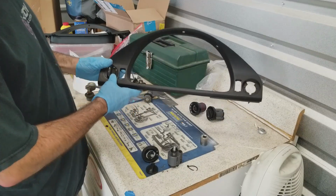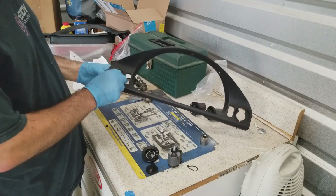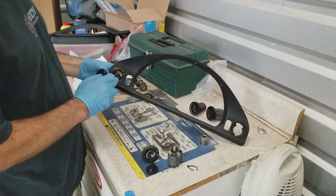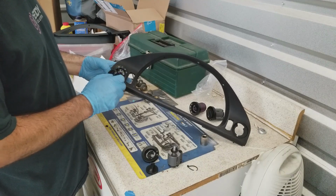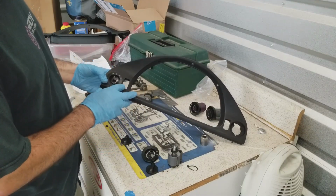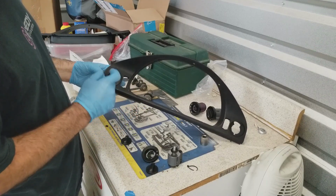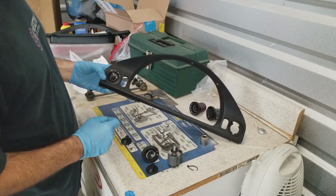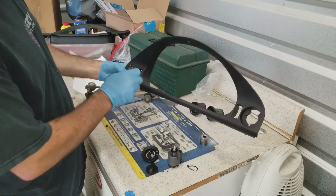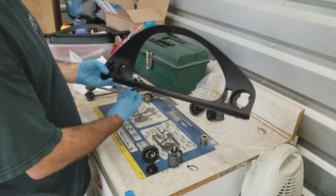But anyway, when this is in the car installed and everything is secure, if somebody tries to pull the knob off, you're actually creating so much force on the plastic part that's broken, it will end up cracking it, and then you're done after that. The whole switch mechanism is really supported by that one little piece of plastic that breaks. So when you are pulling the knob off, all that pressure is on that one piece, because nothing's holding the backside.